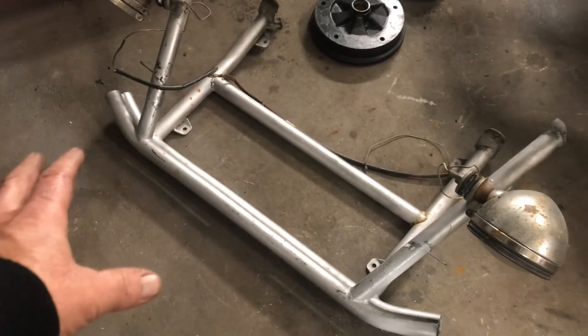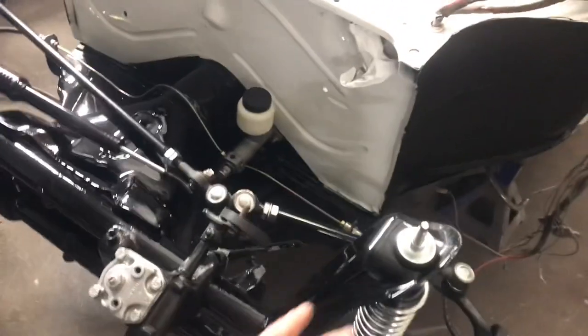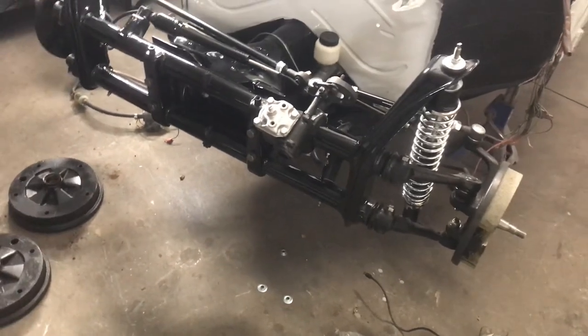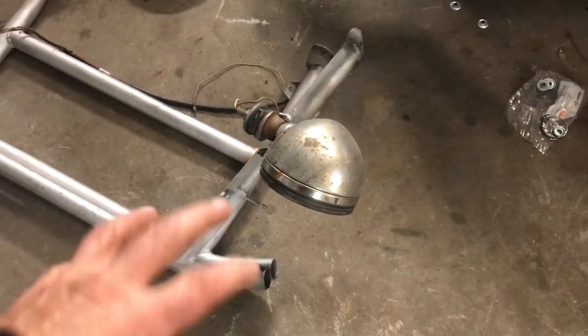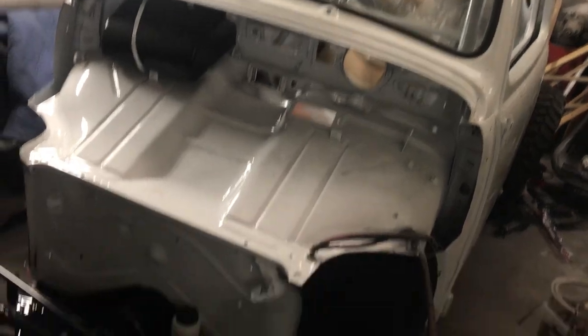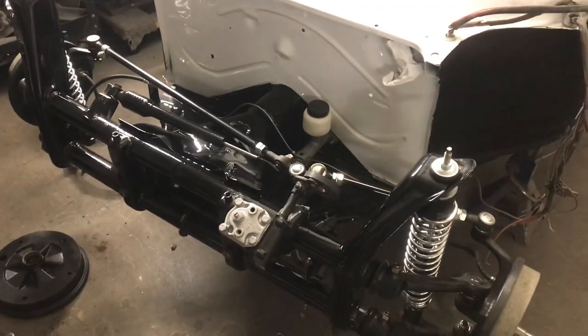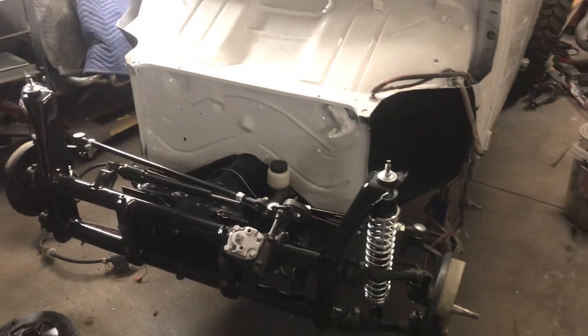The other pain I ran into is this front bumper used to attach to the kingpin beam, so I'm going to have to make some mounts off the top here. I don't think I can incorporate them into the upper shock mount — that wouldn't be very safe — so I'll more than likely have to repaint those towers and weld some brackets on for the top mounts. This job got way out of hand. It came in for floorboards and a scuff and shoot, and we've ended up going through the whole thing. They always snowball.